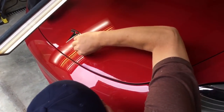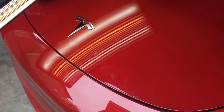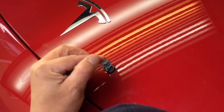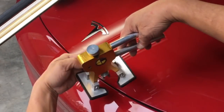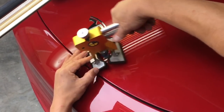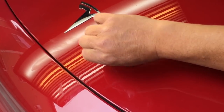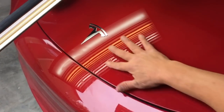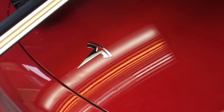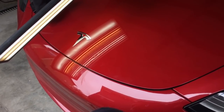As I say slowly, I pull quickly — funny. A lot of it is being moved. I think I'm just gonna go with the patience route and keep trying. One more little pull here, see if I can get the center of that up. If you notice, I'm not waiting too long for this glue to cool either because it is so cold out. Give it a nice pop — just a teeny bit of iso. That's moving a little bit more. Let's see if we can get a little tiny piece of glue in that center.